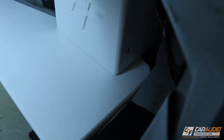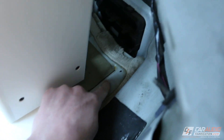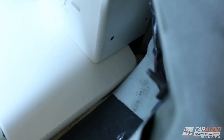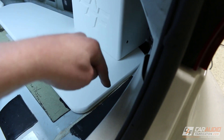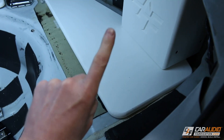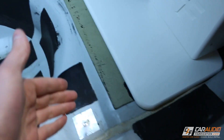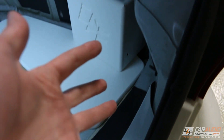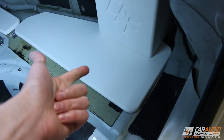What does this process look like? Well, first of all we want to find a spot like this right here — a nice exposed area that we can send a bolt through on our rack. I've also checked underneath the vehicle to make sure that there is nothing in the way. One of the most important things you have to do is check the other side, check underneath the vehicle, and make sure there's not a gas tank or any wiring or anything like that in the way. Let's get this thing mounted.